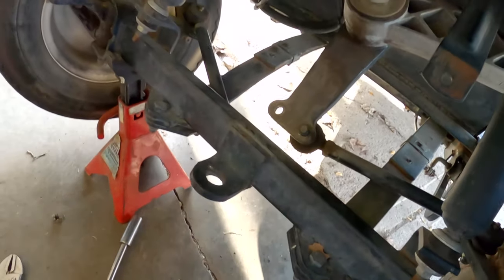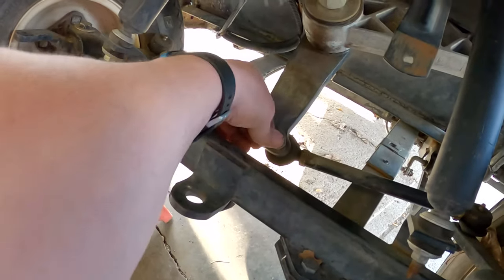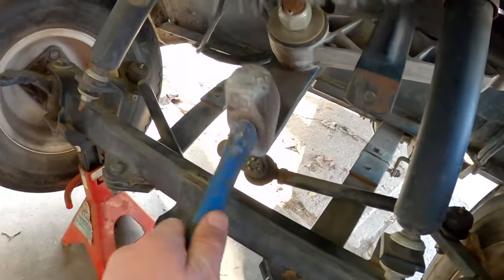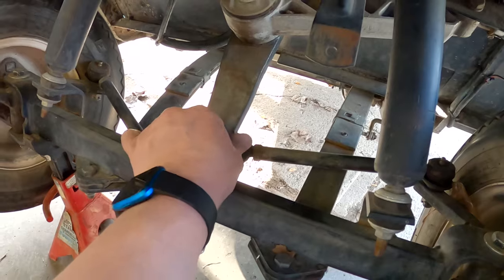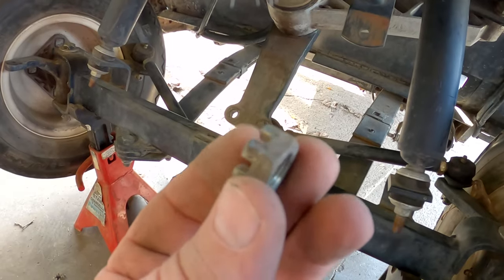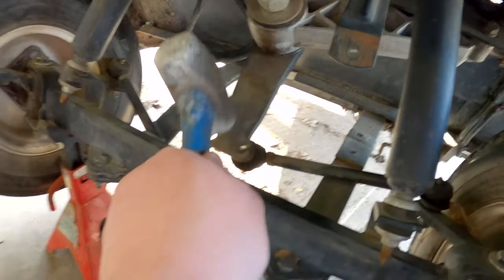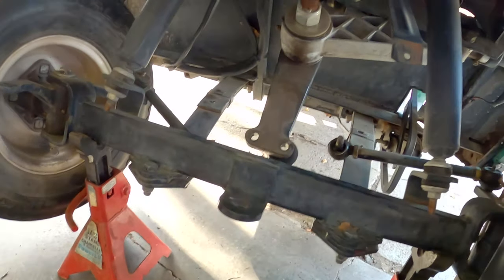The wheel will turn because that's what wheels do. We're going to spin this nut on and do the same thing — give it a tap until it comes out. Unspin the nut. You want to make sure that the nut has at least a few good threads on there, otherwise I have seen the nuts mushroom the heads of these. And just like that we've got this part free.